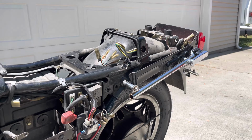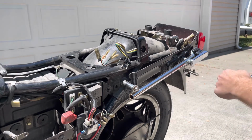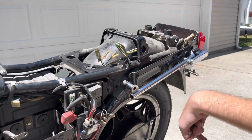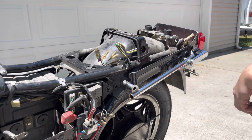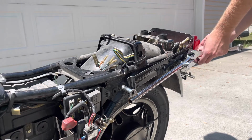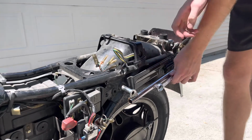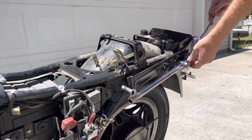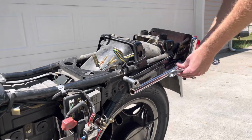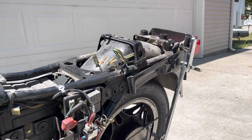So I'm kind of playing this one by ear, but my next thought would be to pull this bolt here and then maybe get a wrench on this. So this is a 12 mil, so we'll go ahead and pull this. Okay, and feels like we're pretty sturdily connected here, so I'm going to try to get a box end wrench on that piece. So we've got to pull this up again out of the way and get a wrench here. I guess this end probably has to come off so that this piece can slide off, so I'm going to fiddle with that a little bit.